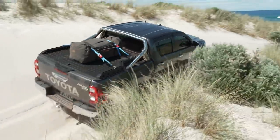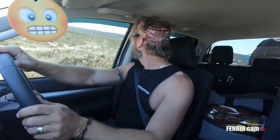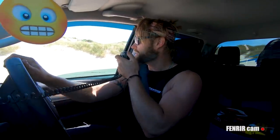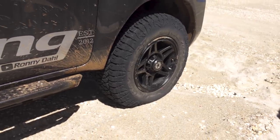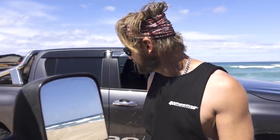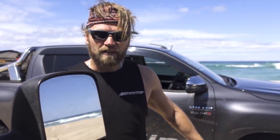Yes. There you go. Made it. First go? Yeah, first go after changing tyre pressures. So what do you think my tyre pressures are down to, Torps? Looking at it, I reckon the front's probably around 6 and the back's about 8. They look really low. 8 and 7. Wow. It was 11 and 9, but after a couple of attempts it heated up and I was actually on 13 and that was on 11. Wow. It heated up by 2 PSI. So I was pretty close.